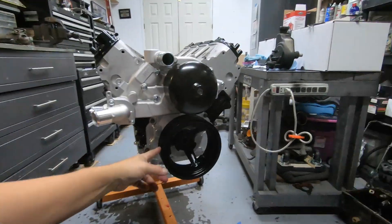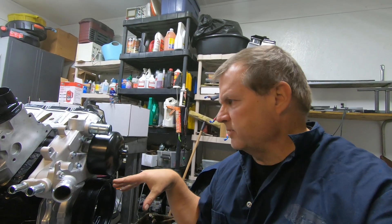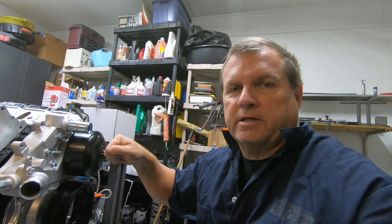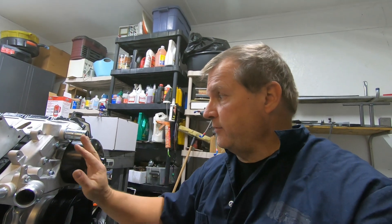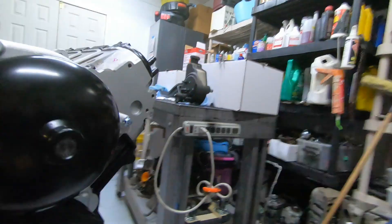If you stick the balancer far out, all the accessories have to stick out to match up to the grooves on the balancer. I'll post a photo in the video about the balancer — how far they stick out — so you can see what I'm trying to tell you. In order to run this type of setup with a truck balancer, this water pump that fits a Camaro has to get spaced out somehow. If you set it flush, it's not going to line up properly — it's going to be sitting too far back.